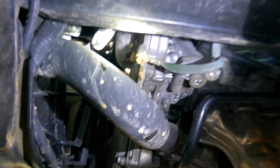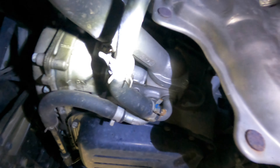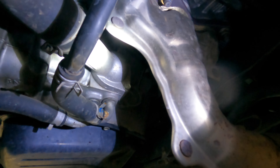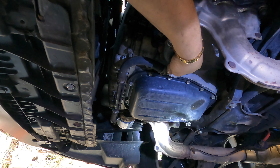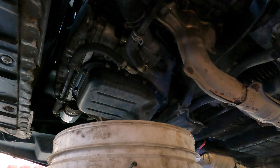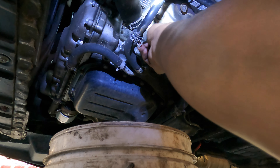If we put the new thermostat in and it's still overheating, we'll have to replace the radiator. You can see the water leak — it looks like pressure, but it doesn't lose much water, just overheating. Anyway, get the number 10 socket, undo this bolt, and the thermostat is in here. Very simple — on the passenger side, number 10 bolt, one inside and one here. You can move it out and replace it. Check this one for any water coming out or any leaks — that's why it's overheating. We try with the number 10 socket and spanner, going for the top one first with a long reach.